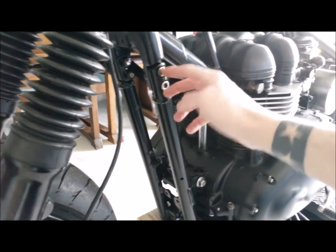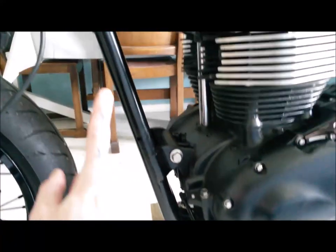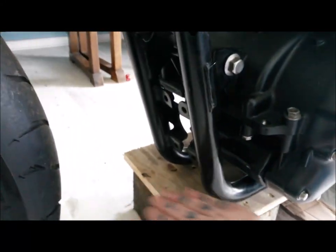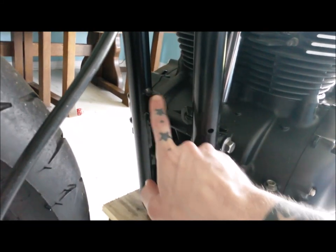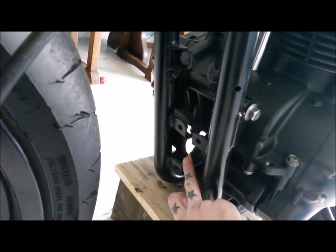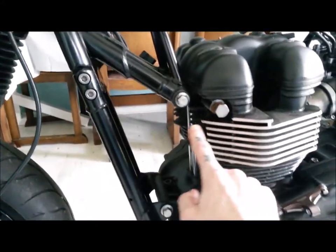What I would like to do is keep this clean look, and the way I'm thinking of doing it: the frame rails are separate units that bolt on here and run down to there. The idea is to actually contain the oil in the frame rails, with some fitting points and a T-section in there to link and cross. The oil will actually be contained in the frame rails. I can then start losing all these brackets as well, and the crossover pipe will effectively replace that engine mounting plate while still keeping the strength.